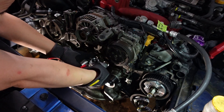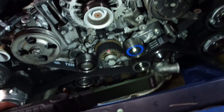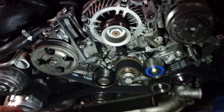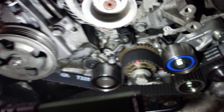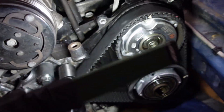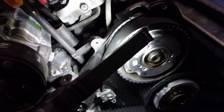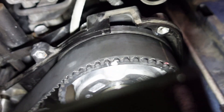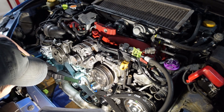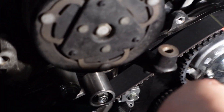Next we're going to install the new pulleys and the tensioner, then struggle to get the timing belt on. It took three of us to make sure the timing belt was all aligned — it's super annoying. The main thing you want to line up are the mechanical tick marks on the gears, which are reference points. When you first install the belt, line up the belt marks with the mechanical ticks. After you turn it a few revolutions to verify timing, your belt marks may be off, but as long as the mechanical ticks are all still in time you're good. Even if it's slightly off — maybe half a tooth — everything should be fine. Another way to check timing is to count the teeth marks on the belt between certain marks. I counted the teeth and we are all good to go.